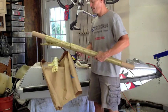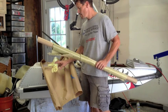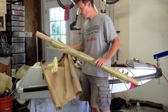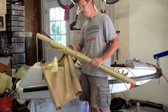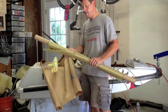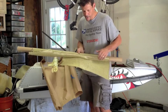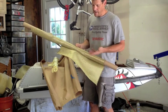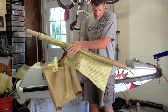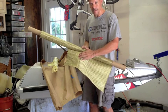And this is really neat looking stuff, and it's significantly cheaper. By the way, the Kevlar was $45 a yard and that's 50 inches wide, so that's a fair amount of material and I used about a yard of it. And then — correction — this is a carbon fiber Aramid weave, which is a really neat looking pattern. A little bit lighter but still pretty strong material. It comes the same way; you have the same challenges. Again the EMT shears to cut it, and I marked it the same way — making a template out of butcher paper, laying it down, and tracing it. This is a little bit harder because it's got black in it and so sometimes you kind of lose your trace lines, but you can figure your way around that.